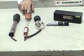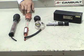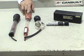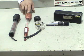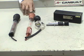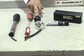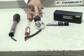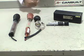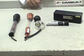If the temperature is above or below that, you will either add or subtract a numeric value from the original measurement to temperature compensate for your electrolyte. The third type of hydrometer has a little floating lever inside that will indicate whether or not you have a good or poor state of charge.